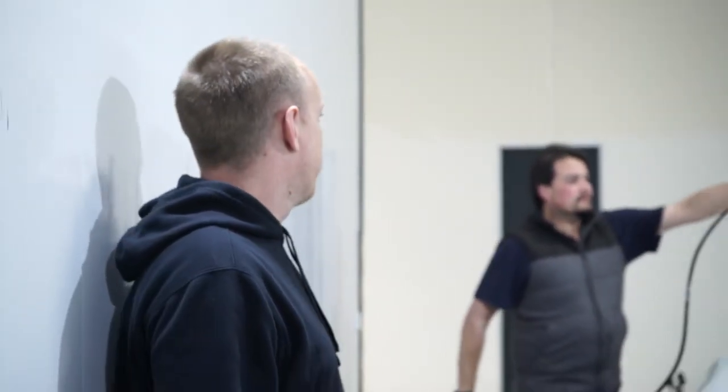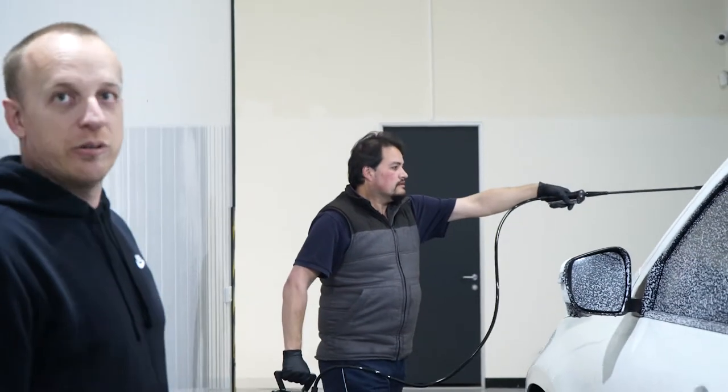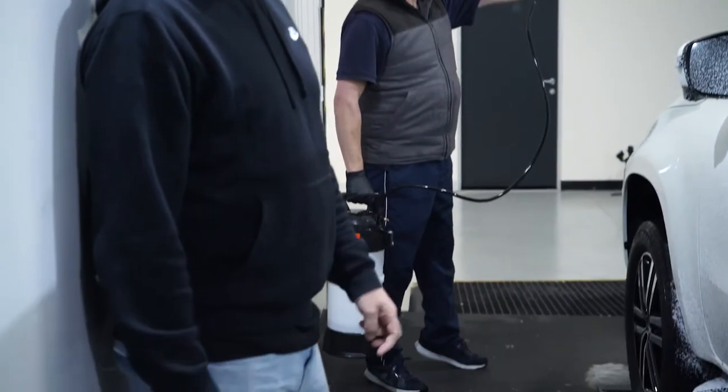It's probably worth pointing out, if you don't have an IK foamer at home, you can spray the product directly onto the paint from the spray bottle. Some people even dilute it down 50% with water, and it's still effective.